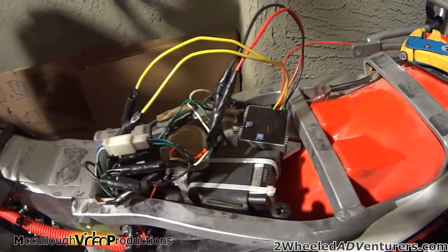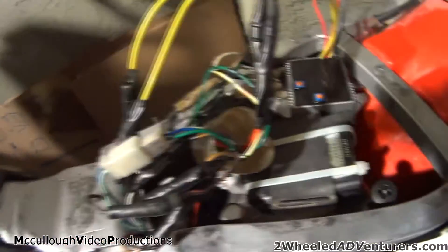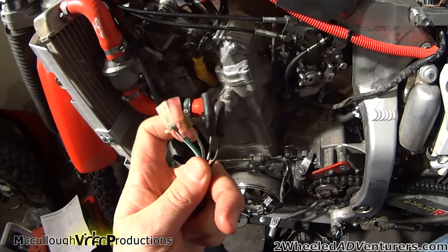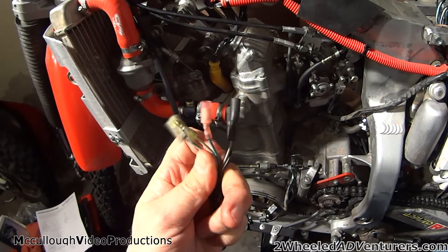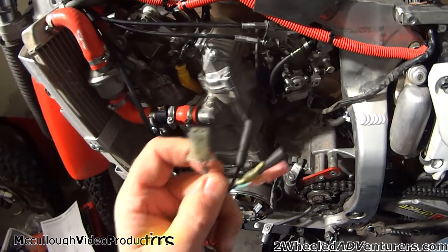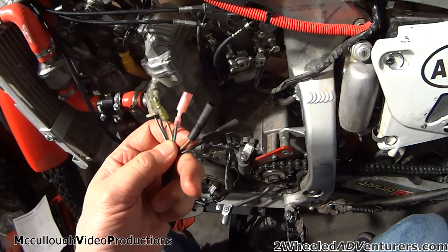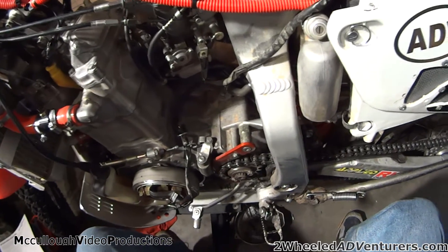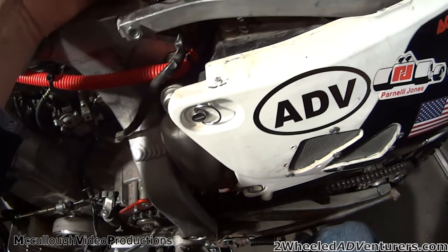This is what's critical. Your stock stator is going to have a black and red, a brown, a green, a white, and then a green/white and green/red — you should be in a hard pigtail connection. So you only have basically six wires. In the upgraded stator, you have two additional that go to the new DC regulators.